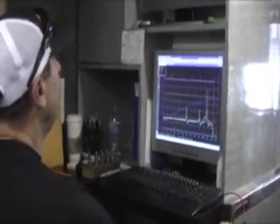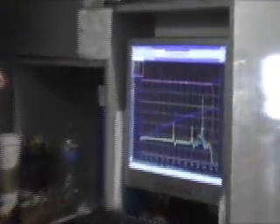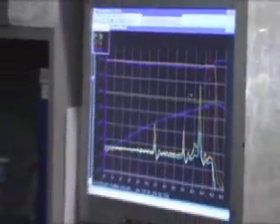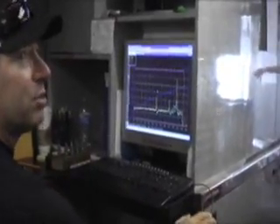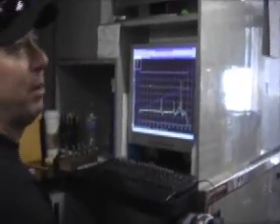It's just a measure number. Up here the little orange line — that's fuel pressure at the fuel pump. The next line, the little blue line right underneath it, is battery voltage. We look to make sure the battery is fully charged — 16.9 right there. And then carb pressure — we've got about six pounds of carb pressure right there. We're making sure that everything is where it's supposed to be, because it's too late when you get up to the start line and find out you forgot to tighten something up.